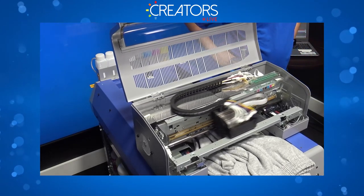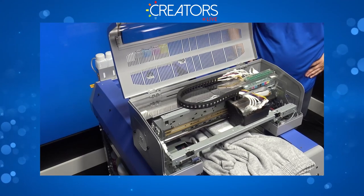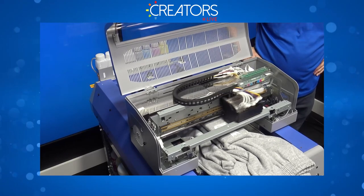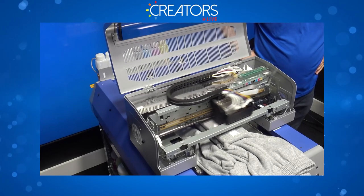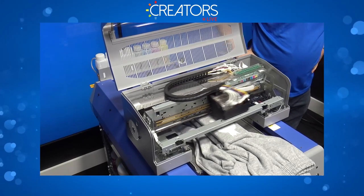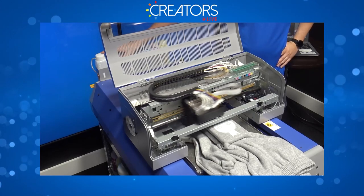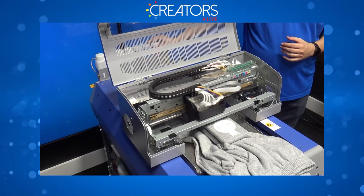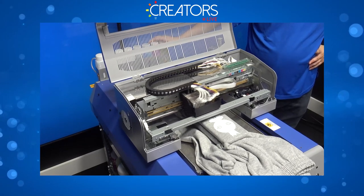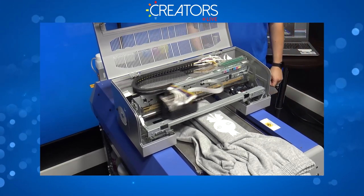Cannon: I have a question about white ink. When you have bottles sitting in storage and you try to shake them, I have trouble really getting it fully mixed. Is it okay to have some residue at the bottom of the bottle when pouring into the ink wells on the back of the machine? I let it sit for an hour before pouring, shake it really well, and try to circulate as best I can, but I still get some residue — I was worried about chunks going through the lines and clogging the dampers, or losing pigment.